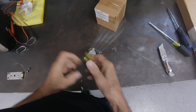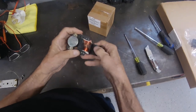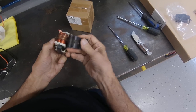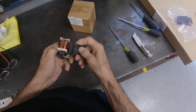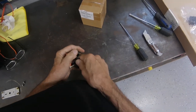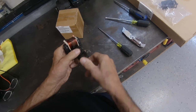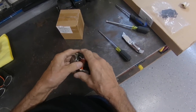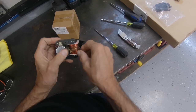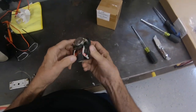I took this black cover off this fan motor here, and you can see the coil is fried. These people had a power failure, and so when the power came back on there was a surge, and the motor was on at the time and it burned out the coil. You can see it's definitely no good — that's why we didn't have any continuity. So now you know.